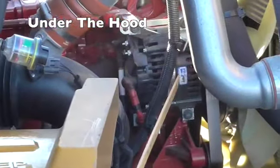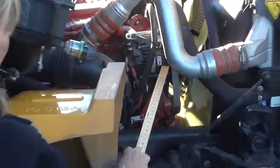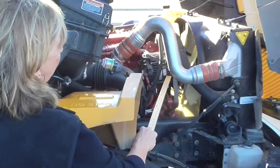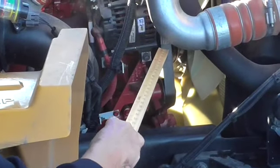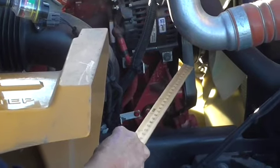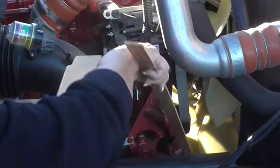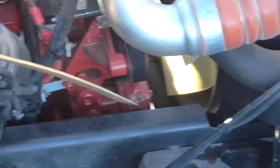Starting on the door side of the bus, this piece right here is the alternator. It's securely mounted with all bolts in place. It is an electrical unit and does not appear to be arcing. It is belt driven — this particular belt cannot have more than three-quarters of an inch of play when pushed by hand, and it does not appear to be dry rotted, damaged, or frayed. The other belt-driven piece is the water pump, right down in here. The water pump is not leaking, securely mounted with all bolts in place, and is also belt driven.